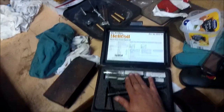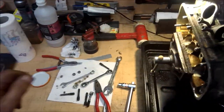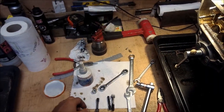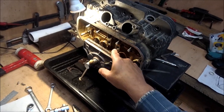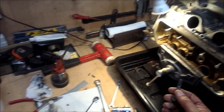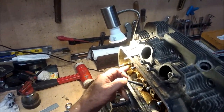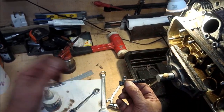I keep this to get beetle engines out of trouble - normally with a three-quarter 19 millimeter reach spark plug it isn't too much of an issue. If it were an issue I would suggest that you get it done rather than try to do it yourself because there's quite an art to using these. I need to find some M7 by 1.0 nuts and then we're going to build this back up. Clean the threads with a bit of acetone to degrease them, then I'm going to use a little bit of screw lock and wind it in to about 36 millimeters.